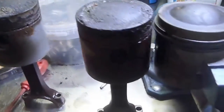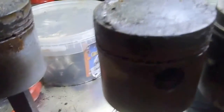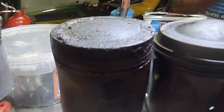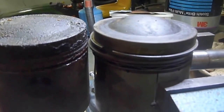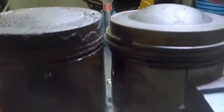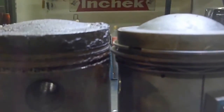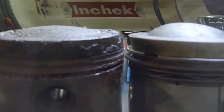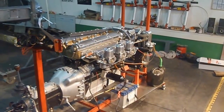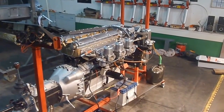If you look at the pistons here, these are the two I got out — these are the pistons from the Mark 10. You can see that this is an 8 to 1 compression ratio, and this is the original E-Type which is 9 to 1 compression ratio. You can see the differences in the dome that's giving it that higher compression. It's a pretty good shot there of the difference. And this piston is out of this engine originally — obviously they're brand new pistons and the engine's been completely rebuilt.